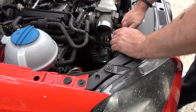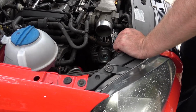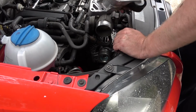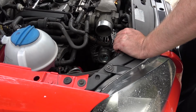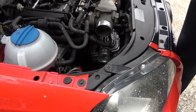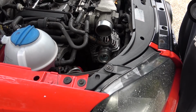Right, so that is now the alternator all secured, back in place. Again, it's just for the tensioner now. The old one's got the 4mm pin at the moment. I'm going to have to put this on, move the 4mm pin back, and then do it like that, because otherwise I'm not sure I'll be able to get that back by hand, because it's a very strong spring. Let's have a look. And not drop the spanner.